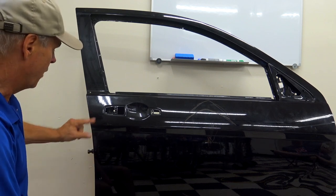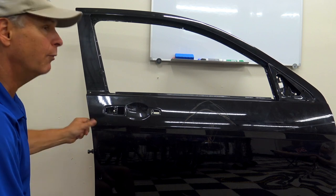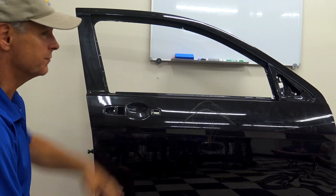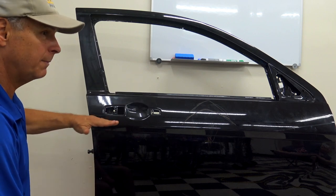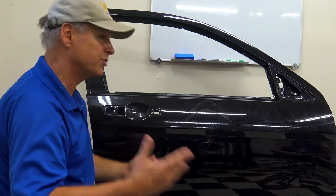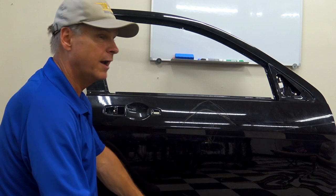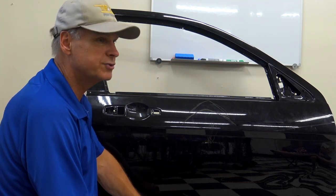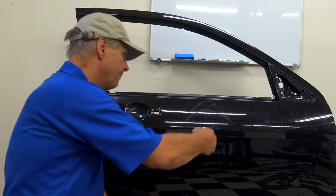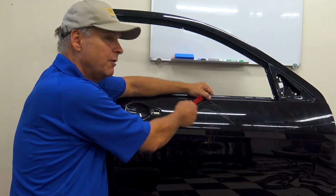People think, well, why don't you put one on the body line as well? Every once in a while, I would do that. But guys, my concern is still those crowns. I will be concerned about that body line when my crowns are up, which, remember, last in, first out, right? You learned that as a bodyman, right? That was one of the guiding principles of Fairmount, last in, first out. People always think, well, that body line kind of went in with the crown, understood, but your crown isn't even your last damage.